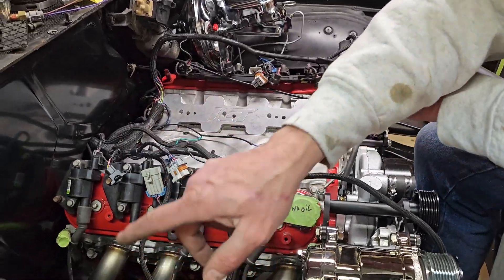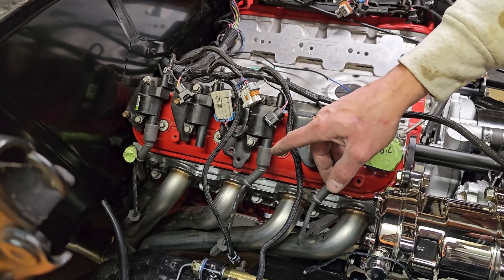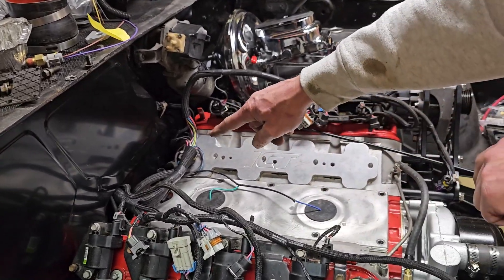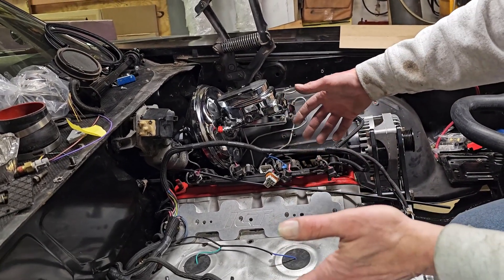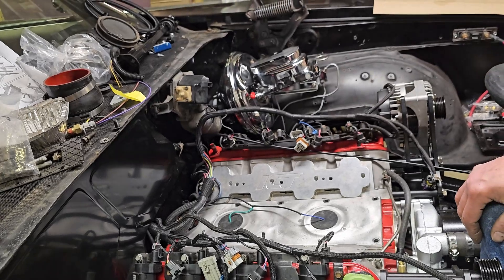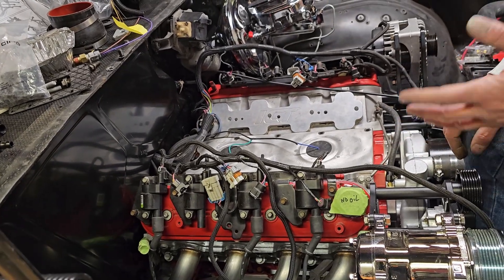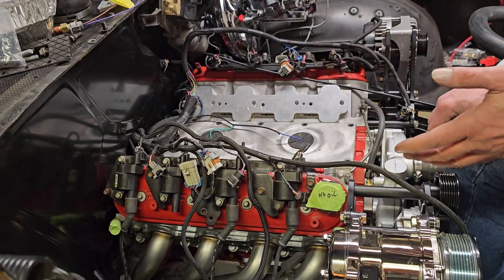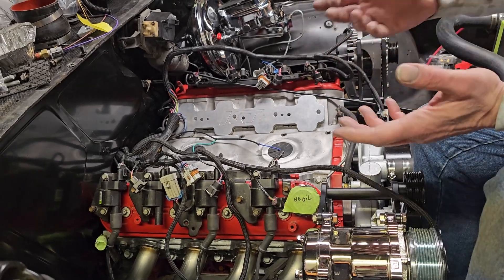There is a crank position sensor that sits above the starter. To recap: crank position sensor down by the starter, cam position sensor up top. Knock sensors on a Gen 3 motor are up top; on a Gen 4 motor they're underneath. A lot of people and a lot of harnesses eliminate knock sensors completely — you can tune them out of the ECU. But in my book, why would you not use them? It's another fail-safe that pulls timing when it senses knock. Faulty knock sensors can screw up the ECU, which is why a lot of people decide to eliminate them.